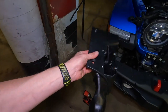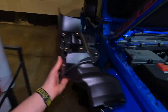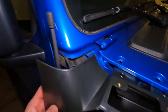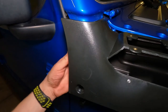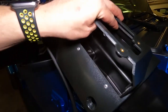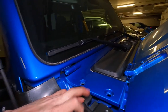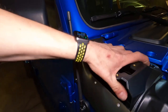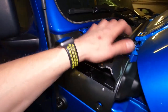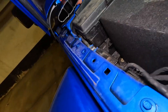At first when I grabbed this piece I thought they sent me the wrong one — the one for the diesel, because the diesel intake is on that side. But I actually had it flipped the wrong way. So this should slip in like so. Moving the antenna out of the way, this might be a two-handed operation. There we go. This is why they tell you to take the antenna out. But there we go — now we have this in there. We can reuse the stock factory bolts to bolt it all up, and it fits around that little piece we cut, clearing it perfectly.